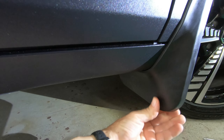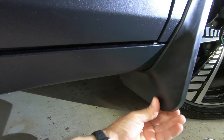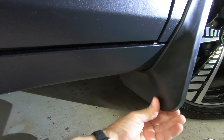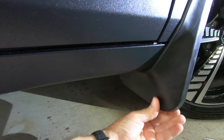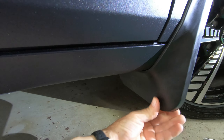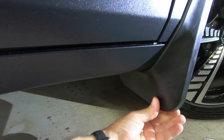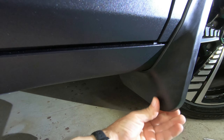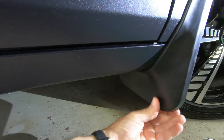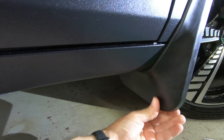The MG doesn't have a jack in it — at least the Australian MG doesn't, because it doesn't come with a spare tyre or spare wheel as standard. So there's no jack and no wheel brace. Luckily I've got all the gear — here is our trolley jack. Normally you'd put the jacking points under the frame of the vehicle where you can see that little cutout — that's normally your lifting point when the car goes up on a hoist at the mechanic.